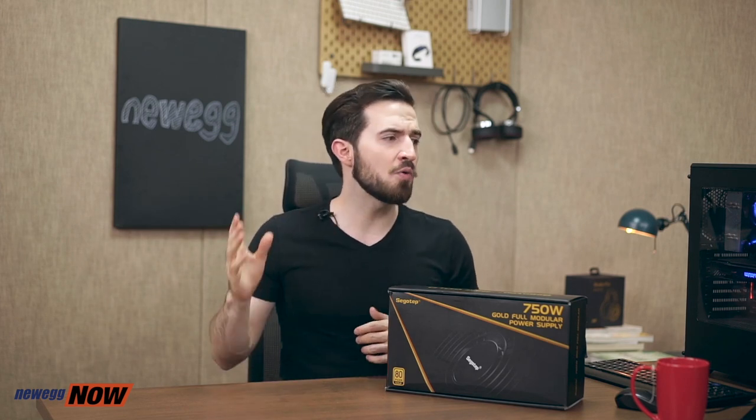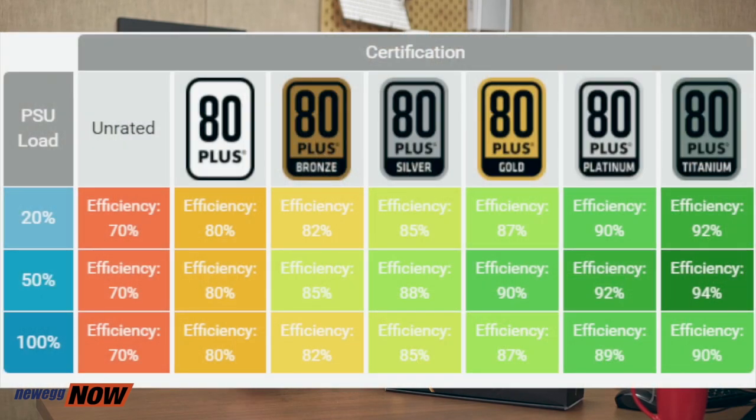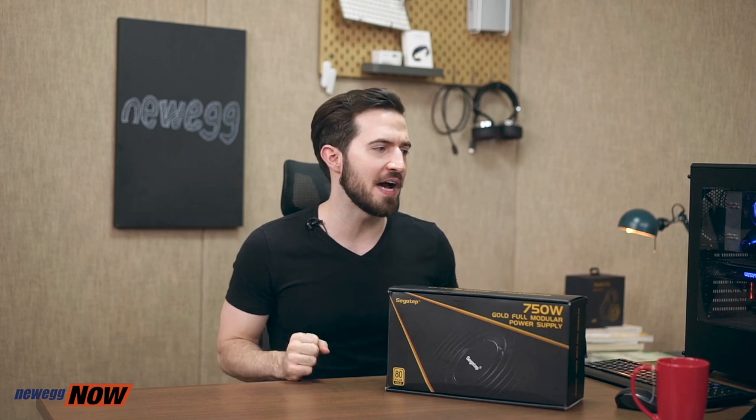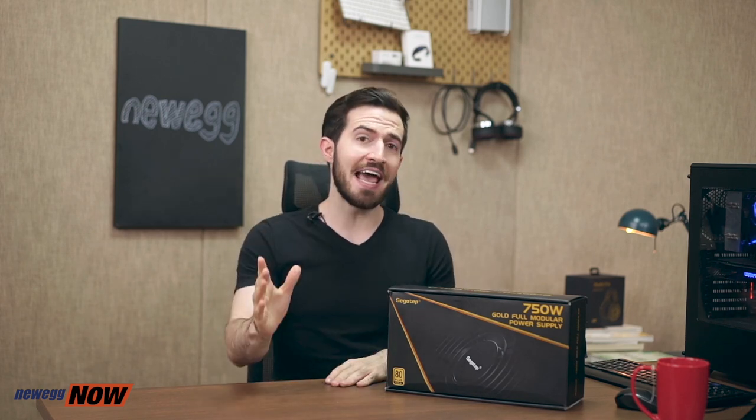This means your entire setup is more energy efficient and environmentally friendly. The most basic 80-plus standard achieves 80% conversion rate regardless of workload. 80-plus gold is 87% to 90% depending on load. Titanium standard has between 90% and 94% conversion depending on load. Products with reasonable prices and guaranteed quality are basically 80-plus gold certified. Spending tons of extra dollars for titanium standard just to get maybe up to 4% higher conversion — I don't think that's great bang for your buck. I think we should stick with the 80-plus gold.